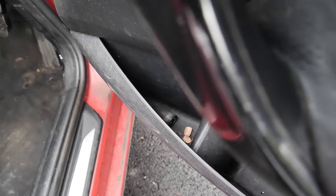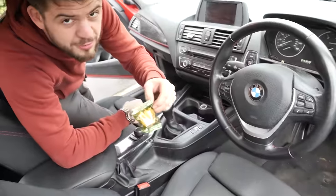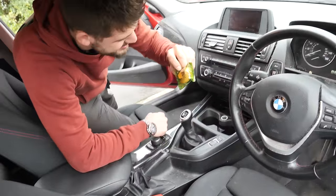The guy that had it — the oil sensor was obviously throwing a code to say it wasn't working. I think he took that as it needing more oil and kept dumping litres and litres of oil in, and obviously the pressure got too high and just started seeping past the seals. We're going to give it a proper clean, take the seats out, wet vac the carpets, give the outside some attention and go from there. I wonder what our real fortune is going to be with this car.